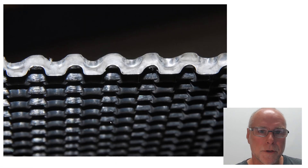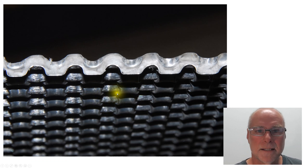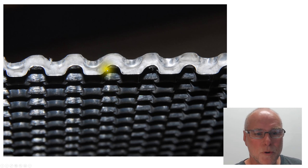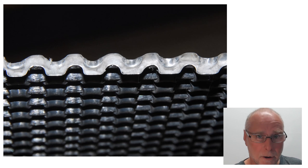So what material do you use? You need to get materials designed specifically for heat shield use. It comprises this sort of dimpled steel, galvanized steel, and in between the two layers there's insulating material trapped in a sandwich. That material was sold for catalytic converter heat shields — it's sold as a general purpose heat shielding material, and it's durable enough to live right up near the turbine of the turbo.